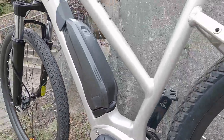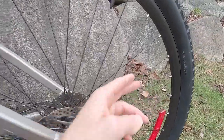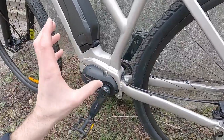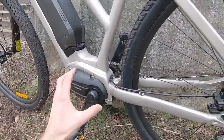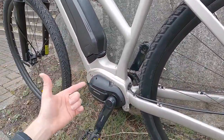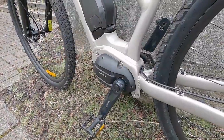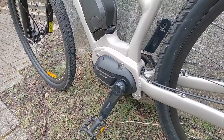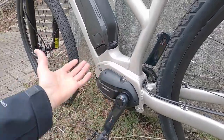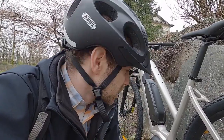Over here we can see a magnet and a little reed sensor. The motor is measuring pedal cadence, pedal torque, and rear wheel speed to be very dynamic. So it's gonna give you a motor output relative to your pedal input — 40 Newton meters of torque. It's rated at 250 Watts nominal, fairly standard. Shimano is a very traditional bicycle company. They don't make speed pedelec motors — they tend to be light, efficient. It's kind of the Japanese efficient, reliable thing. And I like how quiet this one is.